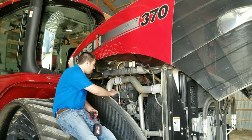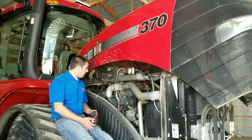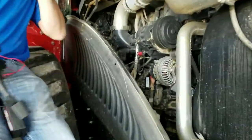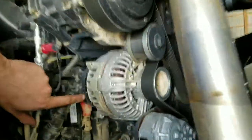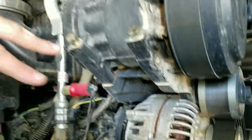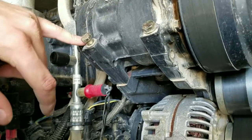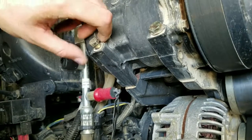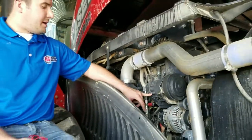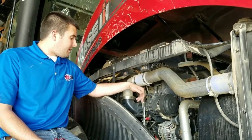I'm going to go through some of our key points and key areas where we're going to be mounting this module. Right here you'll see that we'll have a power and ground strap in order to mount the module. We're going to go to the alternator for power as listed in the install instructions, and then we'll go to the AC compressor bolt which mounts to the engine for a ground. Ensure that you have a clean power and ground — that is very crucial. Make sure that there's no painted surfaces on your ground area or coming in contact in a remote area either.